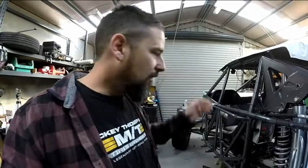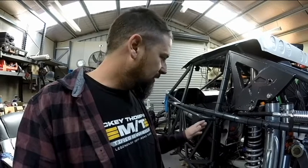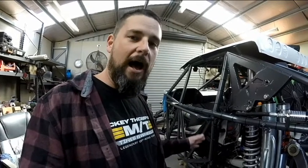Because one thing I overlooked, I kind of thought it was smarter than what it turns out to be. I was treating it like a PLC. I come from an electrical background where I'm quite familiar with programmable logic controllers. And not to mention, even my ECU can do this. So I was a little bit disheartened when I found out the SmartWire couldn't do it, and it was a bit late because I'd already wired it. And that is the output channels are only power output channels.